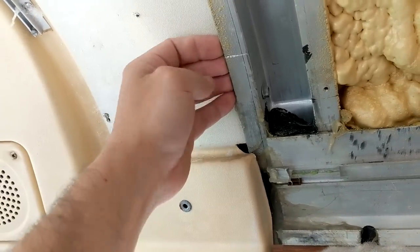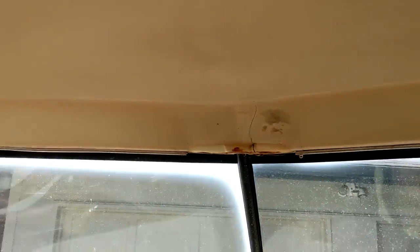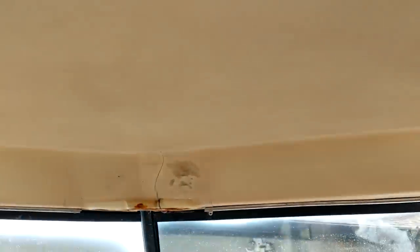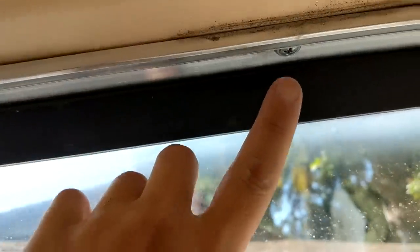This piece slides under the structural rib for the roof. What needs to happen is all the screws at the front need to get unscrewed, and then the whole thing drops out of the front and slides out from underneath. The problem is I've got two screws that are rusted — the nuts are just spinning in place and they have to go. I guess I have to drill out the screw heads. They're stainless, so that's a pain in the butt.